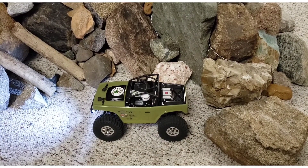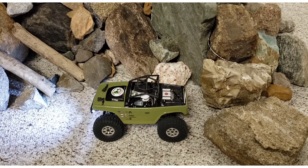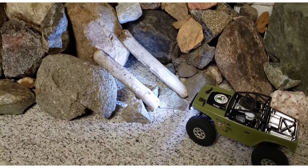Another benefit: when you're going over terrain, since the majority of the weight is in the front of the vehicle, all you really have to worry about is whether the front of the truck tips over. If you drop a rear tire into a hole, you don't want it to be heavy enough to pull the truck upside down. I like the back to be light. My theory on crawling is that it all happens at the front tires — the back tires are just there to hold the car in place, keep the front tire steady. You only need the back to track behind the front tires.